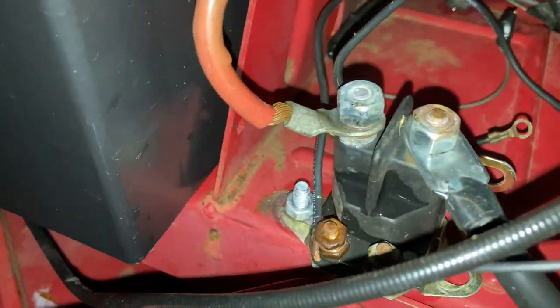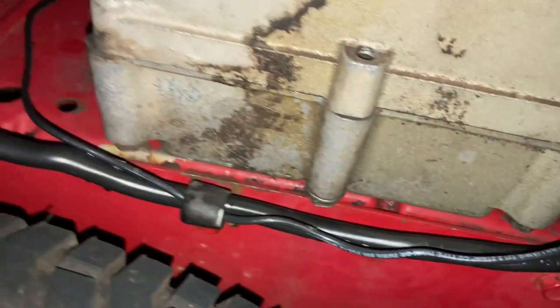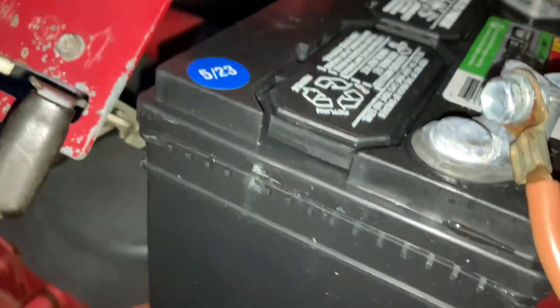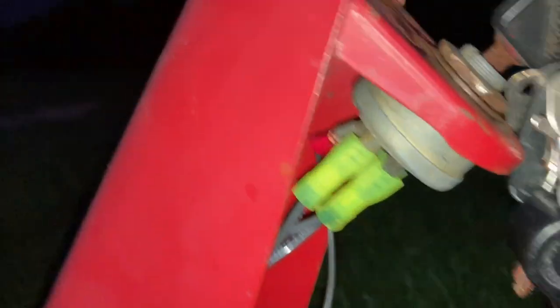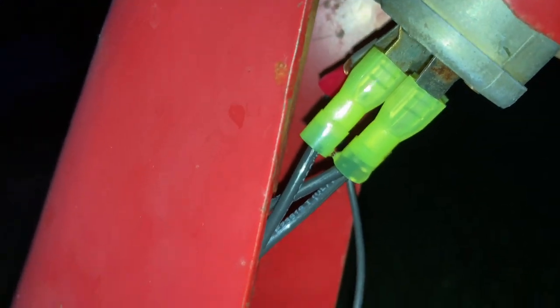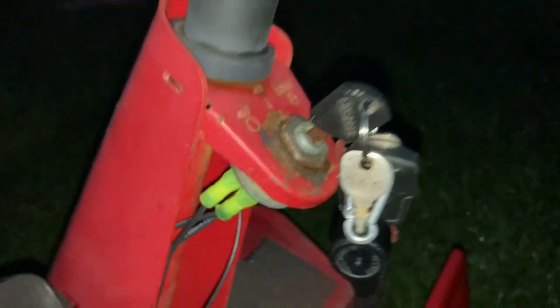Do it right, make it look neat. As you can see on my lawn mower, I did. Make sure to do a neat job. I put that brand new wire back to my starter — it goes up behind the starter, comes down the bottom left side of the engine over to the solenoid. Everything's neat, easy peasy. I ran all the wire through the tube, four wires up to the switch. Cut the wire with wire strippers, put the insulated connectors on there.